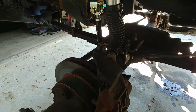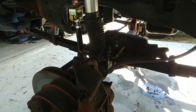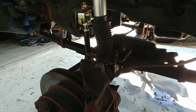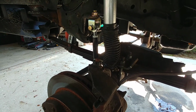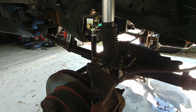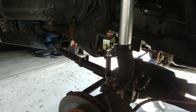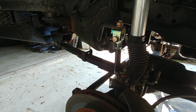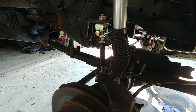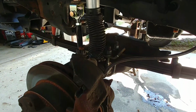Biggest reason for going solid axle swap with the Cummins was solid axle is cooler, easier to work on, stronger. I wouldn't say it rides better. I would say it rides better than IFS with torsion bars, but if you've got a 2-wheel drive truck with coil springs, they are far superior to leaf springs and torsion bars in almost every conceivable way. You can argue that however you want to, but coil springs are more progressive and a smoother rate than just about every other design out there. That's why everything has coil springs now.